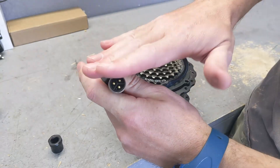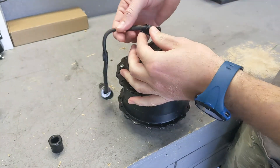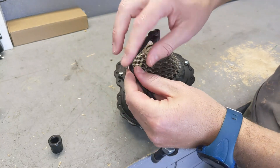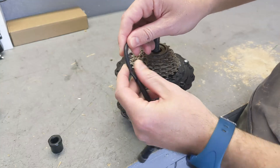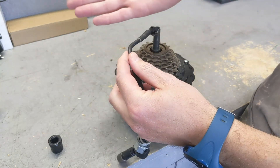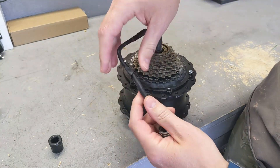Another reason: you have nine wires over here. What happens is they have to skimp on the quality or thickness of the wires going into the motor, so this harness gets very, very hot. It melts, and when it melts it makes a short, and then you're left stranded in the middle of nowhere.